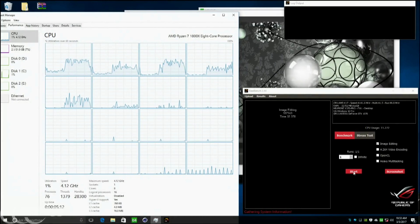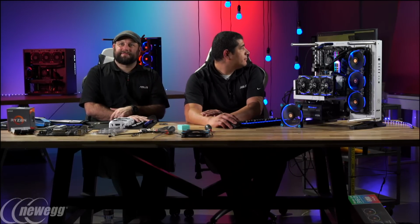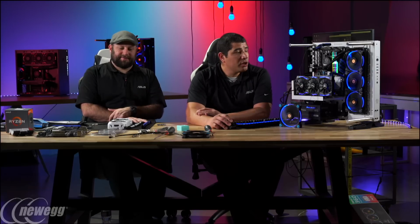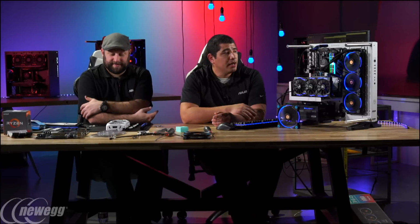It's pretty impressive, and there's some questions online. One of the big questions is: is overclocking dangerous? People have seen in the past where these PCs get super hot, burn houses down. Not really, but talk about the safety features. Should people be worried? The board has a lot of built-in fail-safes in this regard. So if it reaches too critical of a temperature, if something were to happen, the board will automatically shut down. We have certain voltage-defined limits, not only in our UEFI, but also in our software to try to minimize that.